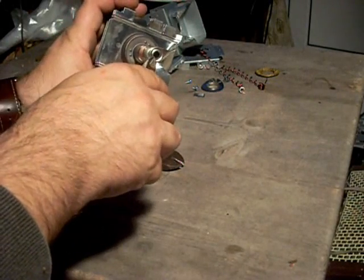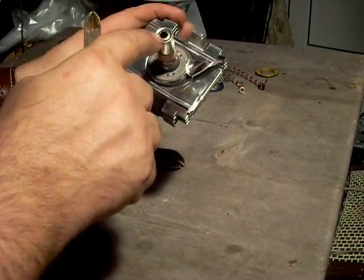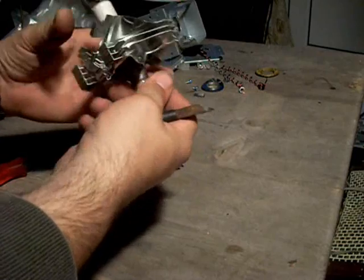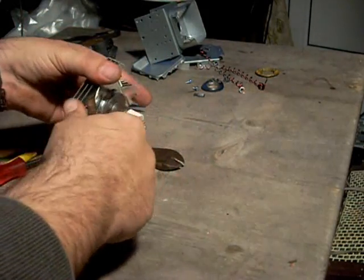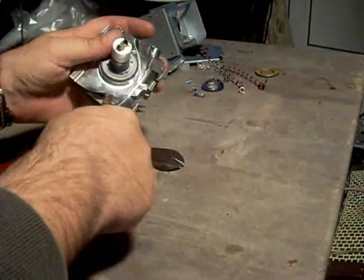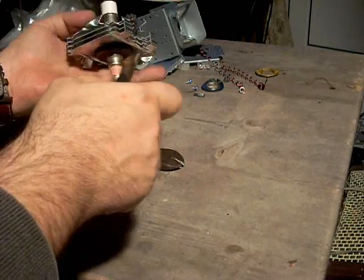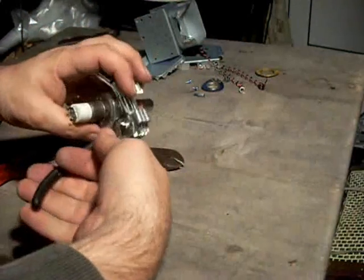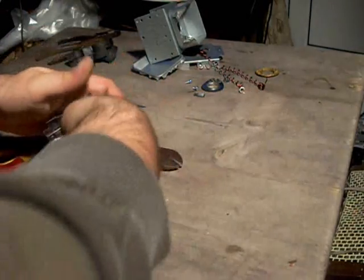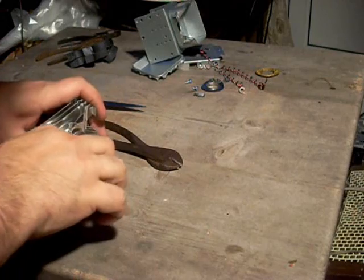They don't come out of the hole — a lot of people think they come out of the hole in the end here. That's purely the sealing pip, where the vacuum is sealed off, because it does work like a thermionic valve. It's not as simple as it looks outside. I will link to the Wikipedia article on magnetrons in the description, or maybe even put a link on the video itself, if I can figure out how to do that. The method of operation is actually quite fascinating. It's quite amazing that they've become such a cheap commodity household item that I can get hold of several of them to disassemble.